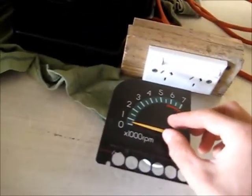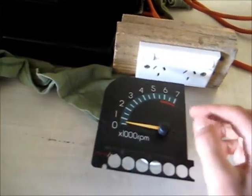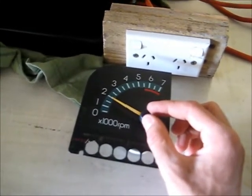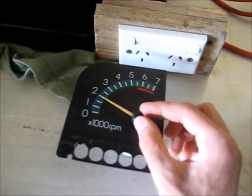Here's a little motor. It's a coil, and it moves along a magnet, and moves up the needle as more current goes to it from the signal from the coil. A pulse drives it, and that just turns those pulses into a movement of the needle. So if the engine's doing 2,000 RPM, there's a certain pulse going to the coil that's driving it, and they convert that into the motion of the needle.